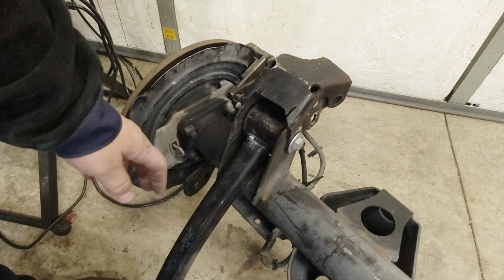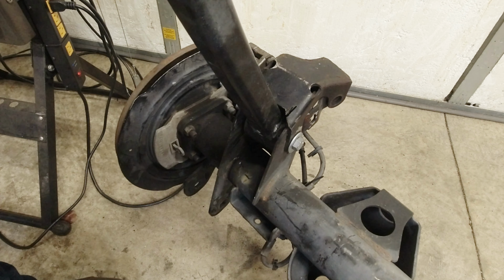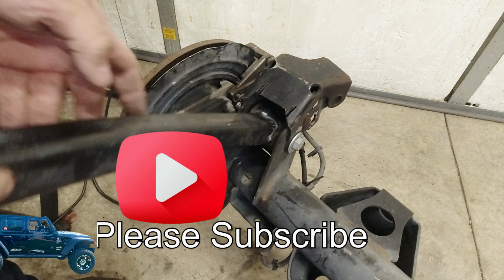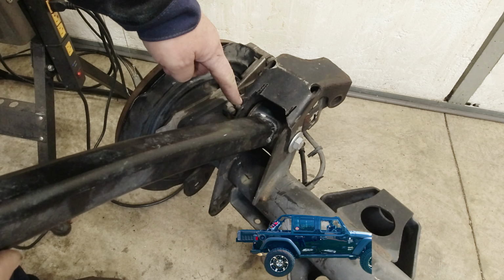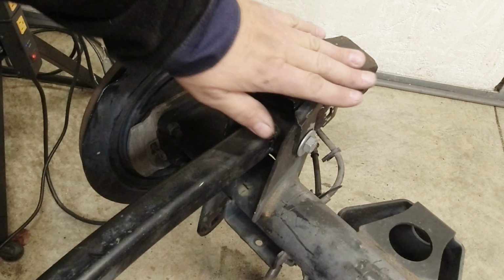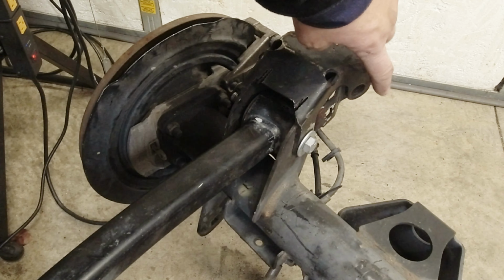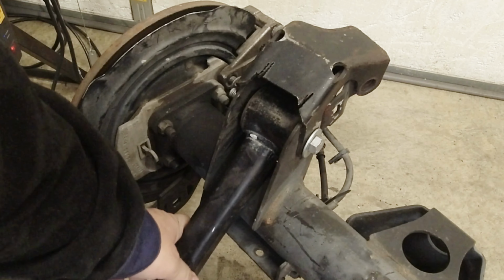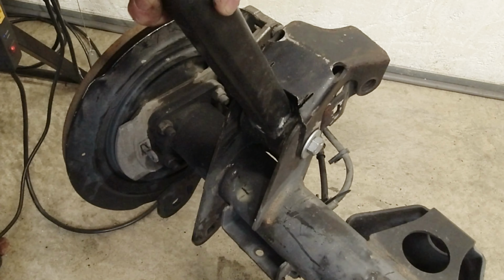Now making room for the arm itself, I know it's never going to be all the way out, because that would be full stuff. So I think we're going to take some guidelines off this Rough Country one. We'll come up to this edge here. So this will just be a 5-inch wide pad that we're just going to connect four of those tabs to. We know at full droop it would never be an issue. It's only at full stuff.